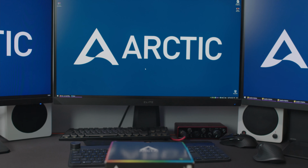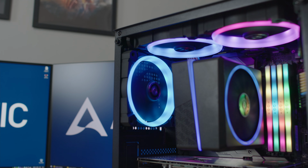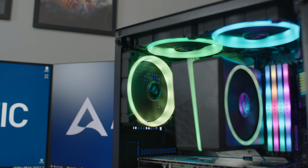So I had to reverse everything and place it right here, so the signal comes from the motherboard to this fan instead of this one, because I wanted to do the connection from this one, second and the third. Now my connection is first, second, third. So it's a bit of a different combination, but you can still manage everything. You just need to be careful not to push the fans, especially not the connectors, so you don't break the pins, because they're quite, let's say, fragile.